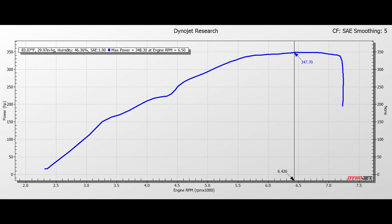We've got a couple new cars coming out to test new motor combinations. The heads responded very well on our stock block TL and put out some numbers we're still impressed with. We've got more changes since then that will make more power, and we're going to start working the block on the newer car to add compression. We've brought out almost everything needed for the heads — CNC ported heads, full valve train, springs, retainers, custom valves, flat face valves. The only thing we feel we're really missing is the cams, and we're currently working with leading cam manufacturers to bring out a billet cam we can custom spec to any need.